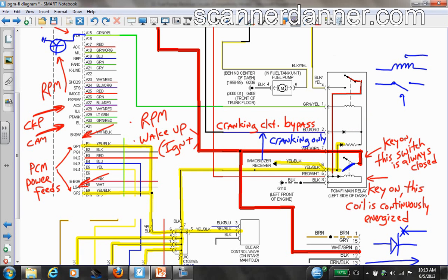Why did Honda put these two relays on a printed circuit board? Because they did — and that's why Honda has this issue. The board has solder joints, and every time these relays cycle on and off, current flows and creates heat, then current stops and it cools off. With 200,000 miles on this car, those solder joints go through constant expansion and contraction, which cracks them. The cracked joints add unwanted resistance, which creates more heat, and that's what ends up melting the joint — like the one we saw in the video.